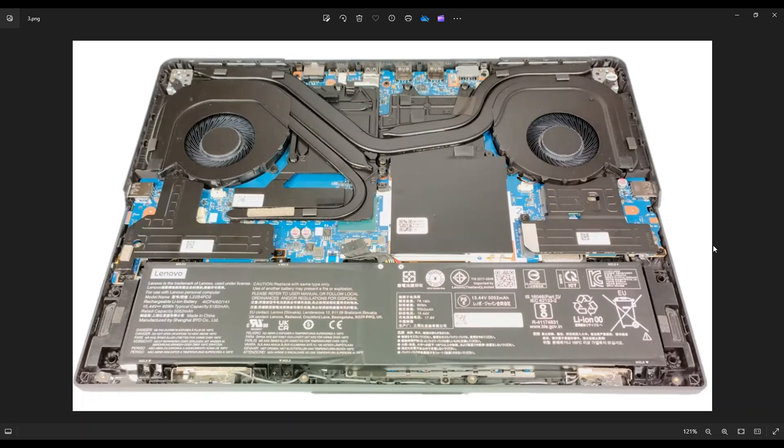Before I do anything in a computer, I always either remove or at least unplug the battery — it makes it safer to work on the other components. Here's the battery across the bottom. There are five screws holding it down: two here, two near the bottom, and one hidden underneath the metal guard for one of your solid state drives. You'll need to take off that SSD shield first — it has three screws: one on the right, one bottom left, and one near the fan. Once that shield is off, you can access that hidden screw.